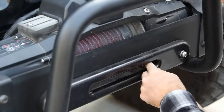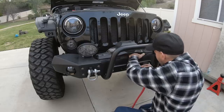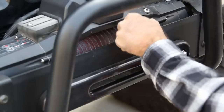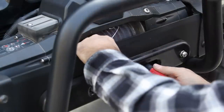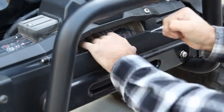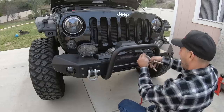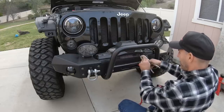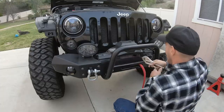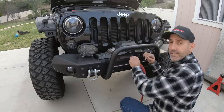You're going to want to go in through the fairlead. I'm going to turn the drum so I can get my wires pointing this way. I can see them out the back there. Now I have my wires pointing this way and I can see the rope starting to come through. I'm going to just pull on my wire and technically this should just work. Kind of just like that. I was ready for a fight — I was really ready for a battle — but that came right through. So now you can see this guy is through. That went way easier than I anticipated.